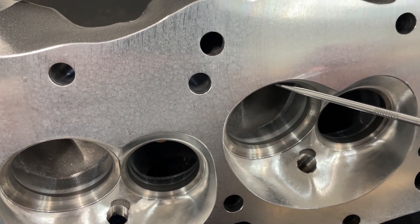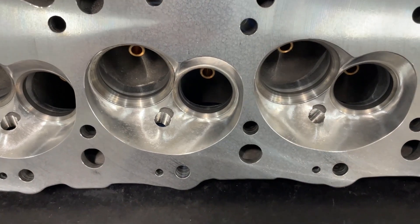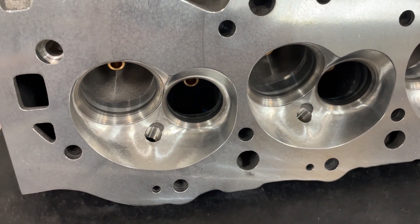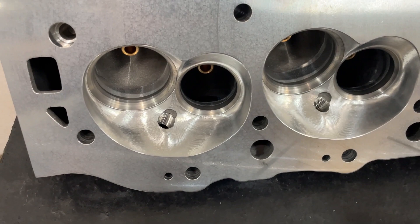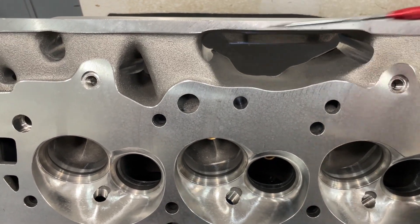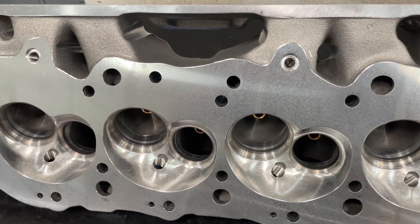You always want to have your angles. Not only do I offset the throat, I also leave all my angles here on the short side. Some people leave them flat — I'll take off some but not much. I already cut one of the heads with the valve job out to a 2350; on a bigger bore you should probably do that. I'm going to flow two runners because on a big block Chevy you have a long runner and a short runner, so you'll get both flow numbers, plus the exhaust port, since all the exhaust ports are the same.